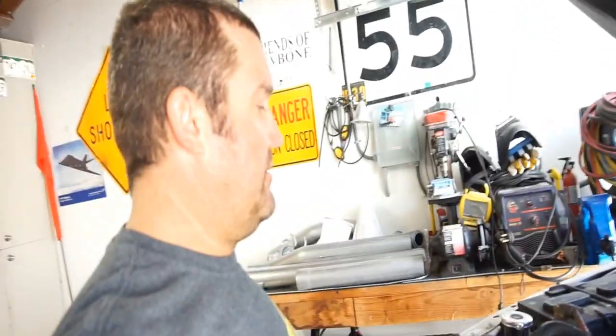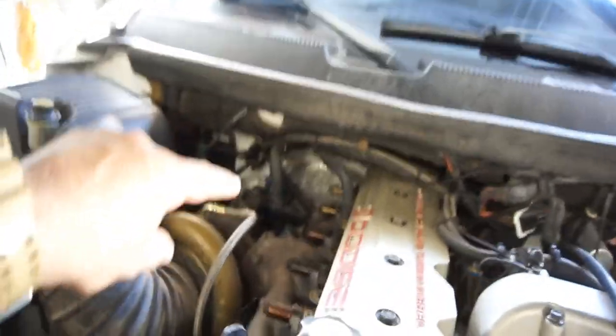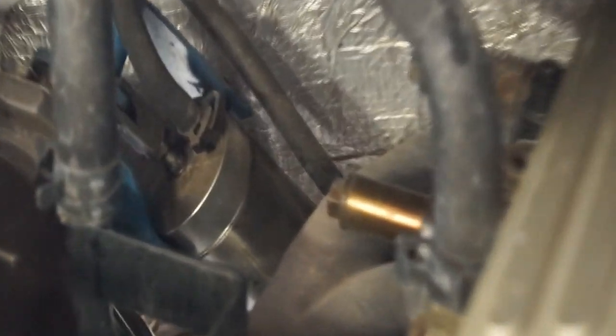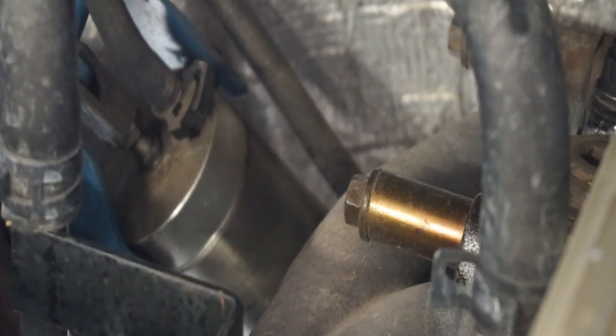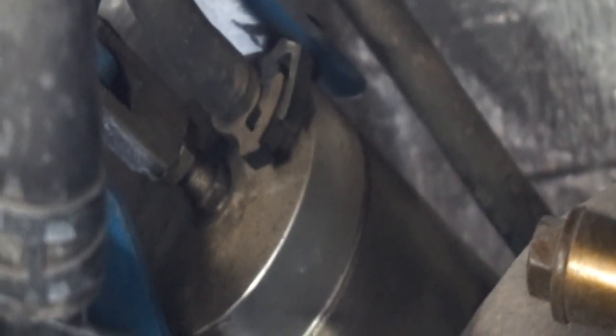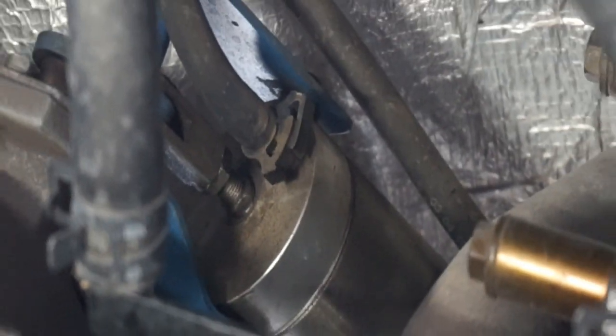But yeah, so I messed with that. It's actually the seals on the brake cylinder. That piece right there is just a cylinder like a piston, and it holds pressure. And that rod right there goes in and out to actuate the little butterfly that's in that elbow. Anyways, the seals on those are blown. So when you lubricate that piston or that rod, it'll be good. The exhaust brake will come on and off when you select the switch.